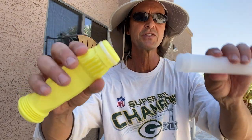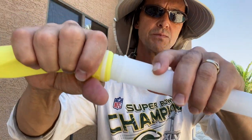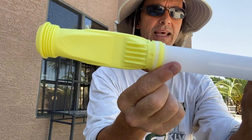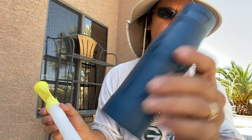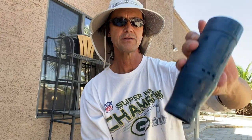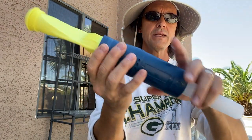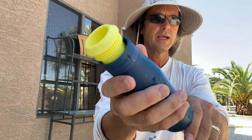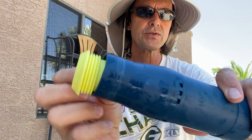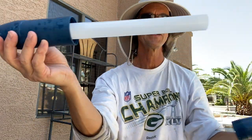So this is my new diaphragm — very simple. You notice the end has a little notch in it. I'm going to put it over the post and wiggle it, and it's on, just like that. Now carefully, so I don't hit that little ring in there, I'm just going to push this back through. This is the bottom that goes down to the pool where the suction is. I'll feed it right through and wiggle it gently until this yellow lip seats right on that blue frame. That's it, folks.